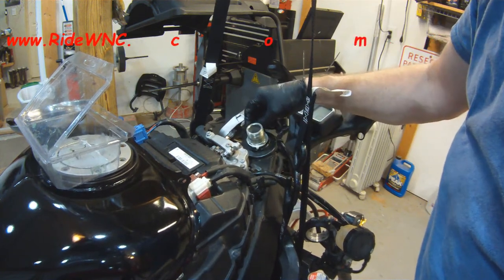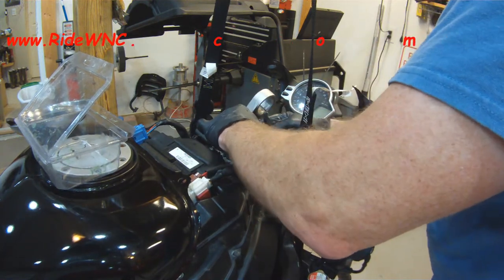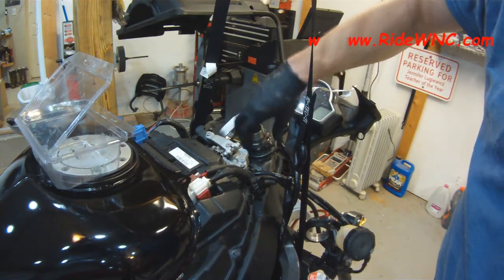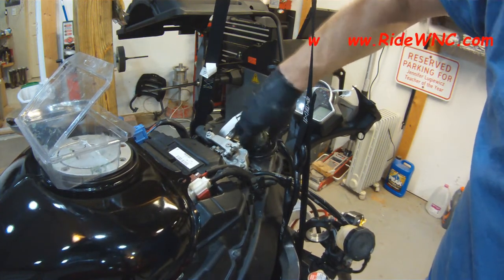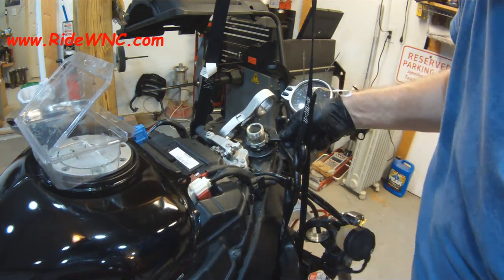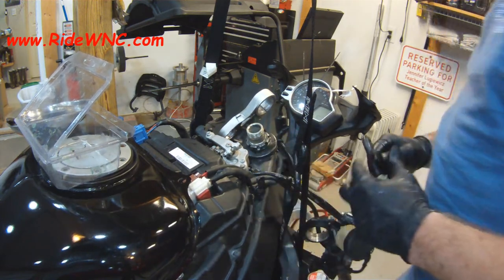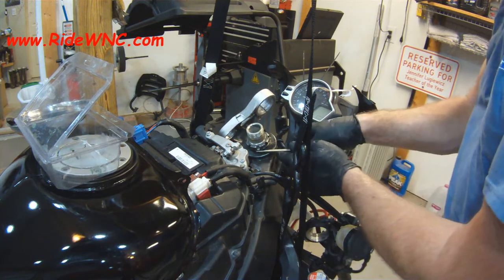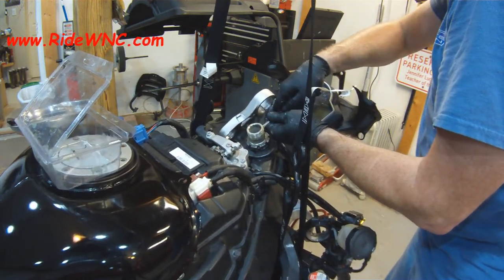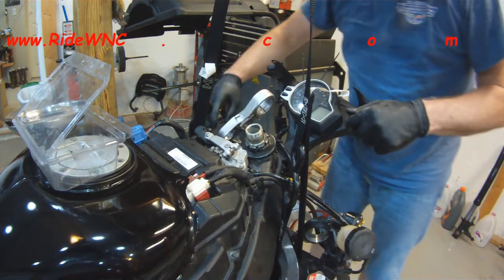Here is our little retainer — this is kind of a lock washer that'll keep that steering stem from backing out. The nut that was on top of this was really loose — it was only finger tight. That's not going to happen this time. We're going to put at least 15 pounds of torque on this nut to snug it down, and turn it to where it lines up with the tab, then hammer that tab in. When I come back to take this apart in the future, it's not going to come off just finger tight like it did. With my screwdriver, I'm just bending those tabs back into place, and then we can put our upper triple tree cover back on.